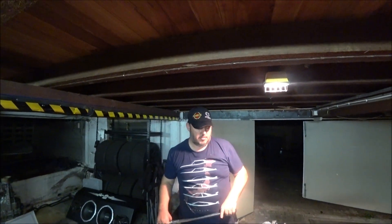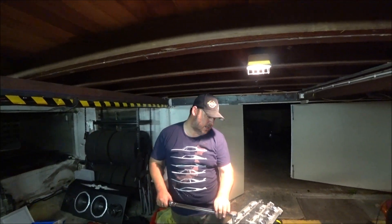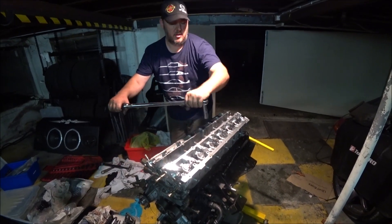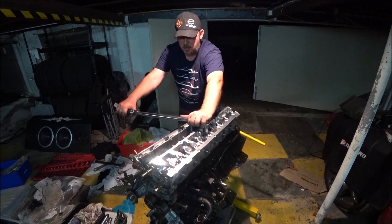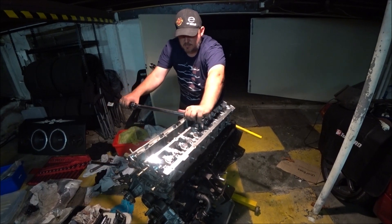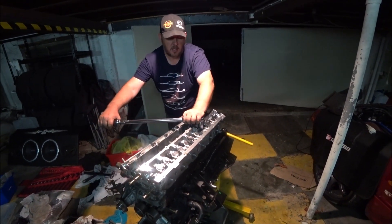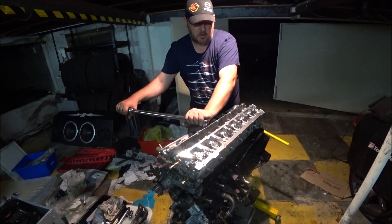When I went back over them at 60, the middle ones had slackened off a bit, so I'm going to go over them again. On the 90 that's got them to do up a little bit in the middle and not too much to the outside. That's why we redo them - I got a quarter of a turn out of that, quite a bit out of that one. As we get to the outside we'll get less because there's more tension on the other one still.